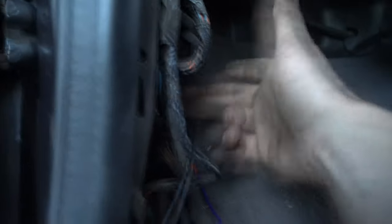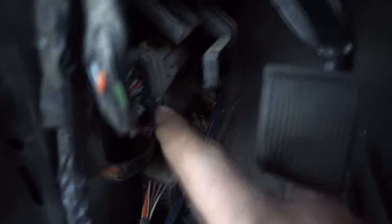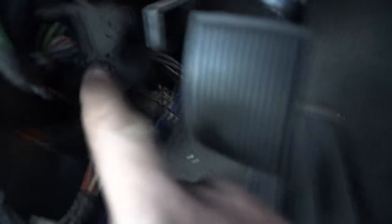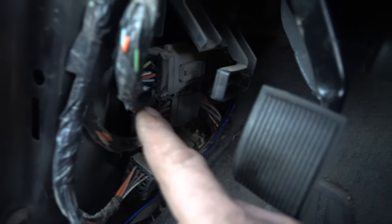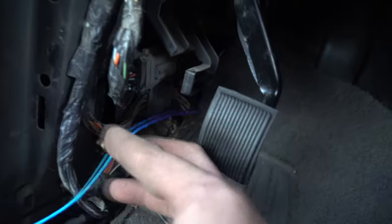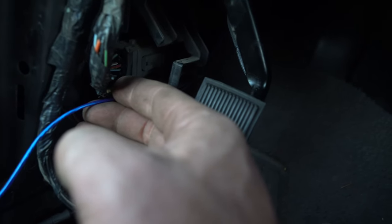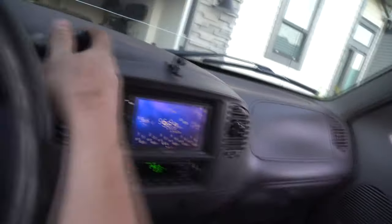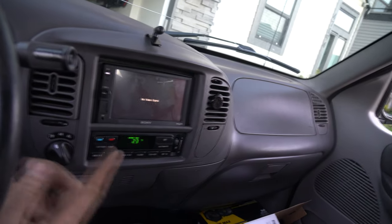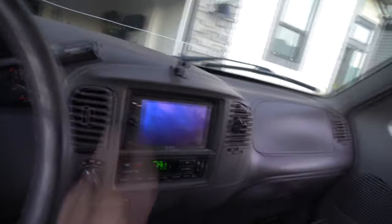If there is a wire for us to tap into for reverse, it'll be right here going to the rear of the vehicle. I'm going to check if there's a reverse wire in this driver's side kick panel. See this top plug right here — that black and pink wire is the reverse wire. Wire your blue wire, or whatever color you have coming from the reverse wire on the deck, right to here and hook it up. Make sure when you shift to reverse and back that the backup camera kicks in — watch this — reverse — 'no video signal' because we haven't hooked up the camera yet. Perfect.